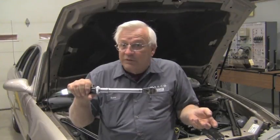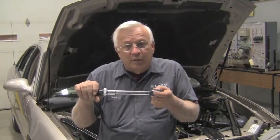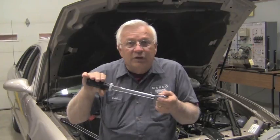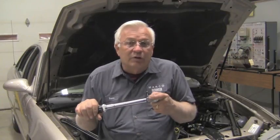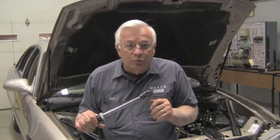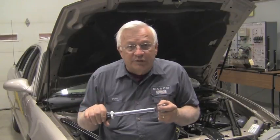My short-term might only be reading 3%, and if I looked at only short-term I might say 'well, 3% — that's well below the 10% acceptable level, so that's good.' But that's where I need to look at long-term as well, because short-term is not enough. If it can't do it, it goes to long-term. We're looking for a combined no more than 10% acceptable level. Short-term won't set a check engine light — long-term will, if it cannot maintain the air-fuel balance at an acceptable 10% plus or minus level.